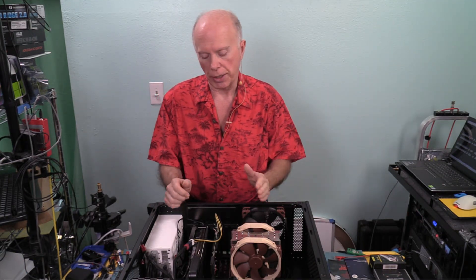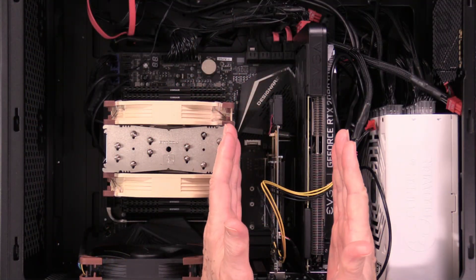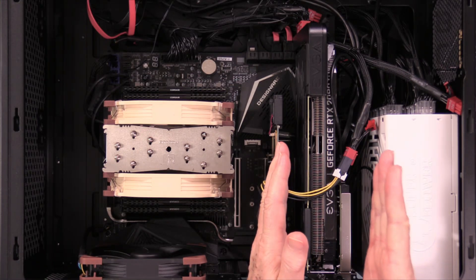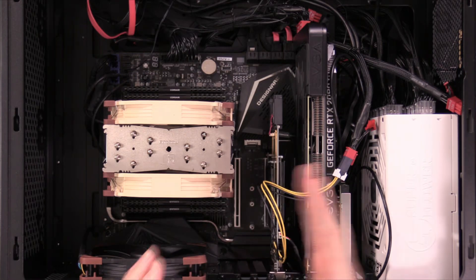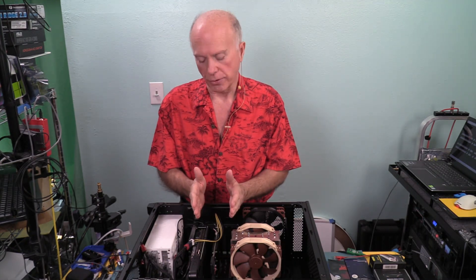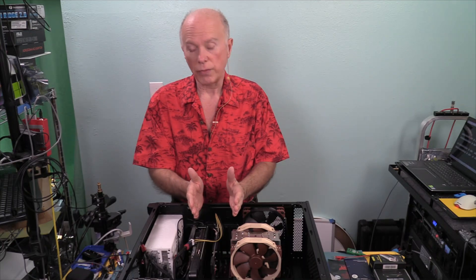To address 32 drives in one machine with two 16-lane slots: two quad cards gives us 8 drives. If we have two 16-lane slots with two 8-drive cards, that's 16 drives. That leaves our two 8-lane slots — one for the regular GPU so we can see what's going on, and one for the GRAID to manage the RAID configuration. So that taps it out. Even though we can experiment with that on a TRX40, to maximize 32 drives on a single system you really need a workstation. We need four 16-lane slots — whether quad cards or 8-drive cards.